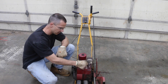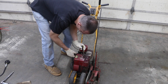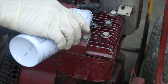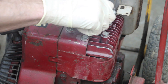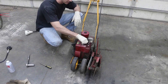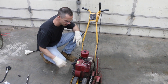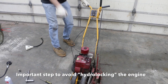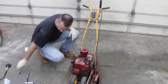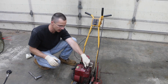What I'm going to do now is take this apart. It looks like the piston is pretty much at top dead center — I'll try to get it very close. I'm going to put the spark plug back in to hopefully allow any sort of steam or vapor to stay contained. It's been about 20 minutes, so I'm going to go ahead and remove the spark plug and try to remove some of the excess fluid. This is probably going to go everywhere. Alright, that should be pretty good. I'm going to go outside and start this up and run it for a few minutes and then run a compression test.